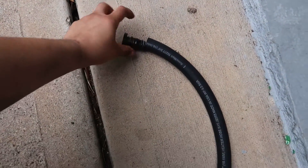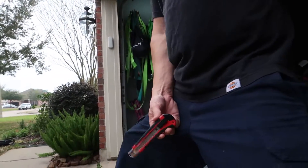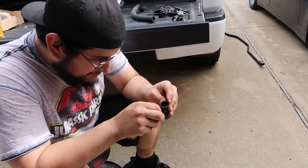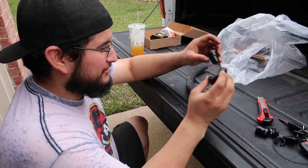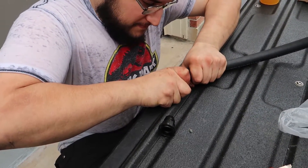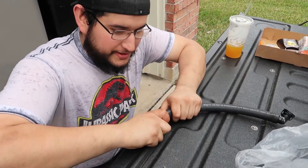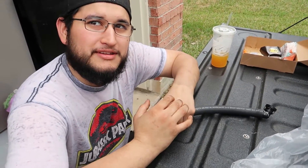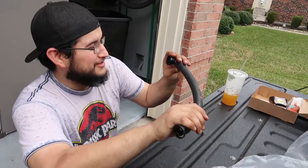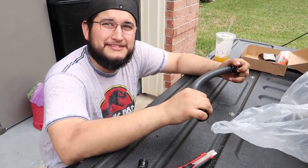This is the only size they had and it's just a little bit too small, but I'm going to get a blade and cut off that remaining hose from the end and it should be good. I got both of the crumbling fittings cut off and pushed the new hose on - that's a really good fit. Should be a better, more permanent fix than just slapping a tube of silicone over it like the previous owner did. Now to zip-tie it.